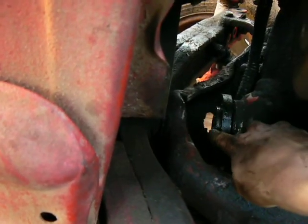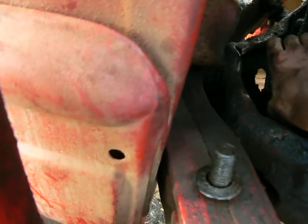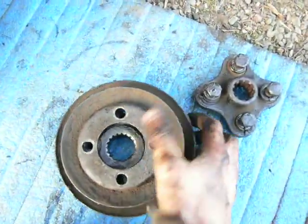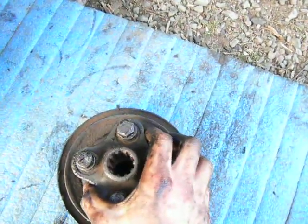Just like that. And then this bolt goes through into the middle of the crankshaft — there's a threaded hole. Then through these four holes, the pulley lines up with the holes in the pulley, and then that thing bolts on. So it's all held together.